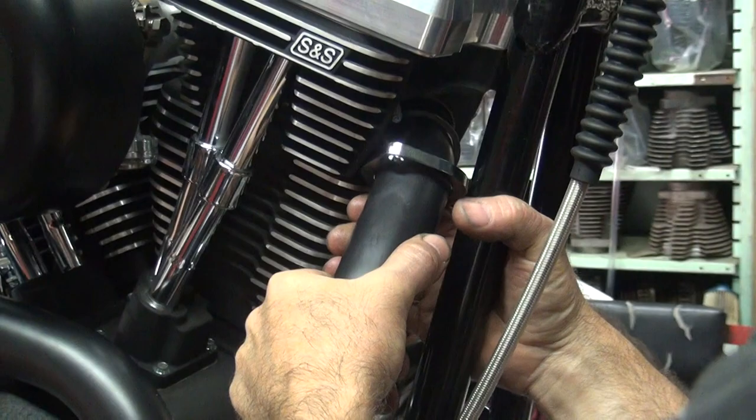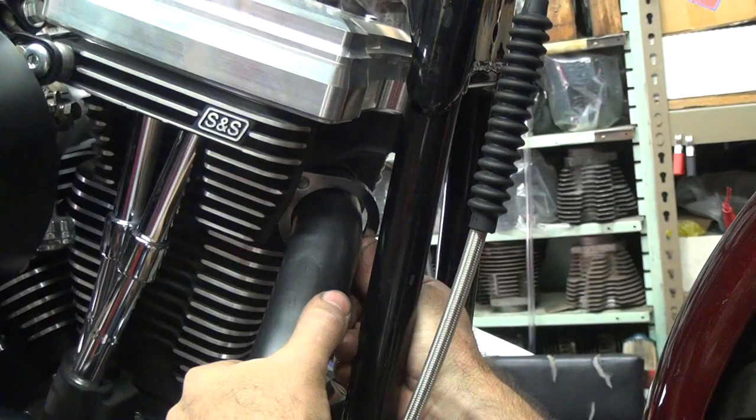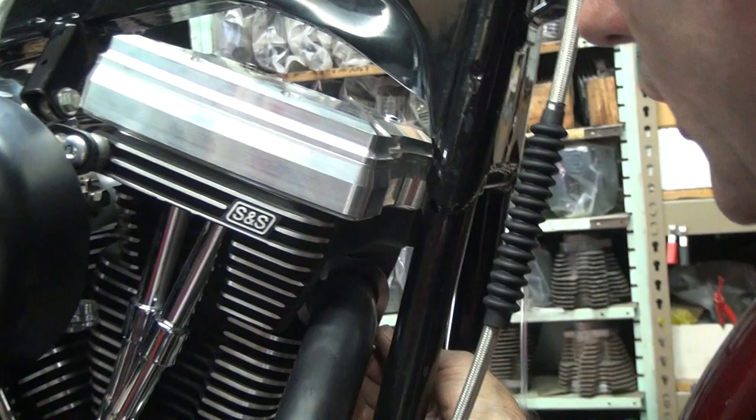Okay. See, this here, what I do, I take and I pull on it to get it to put the gasket in. The problem is the gasket's already damaged, but I'll have to live with it that way. Trick is you gotta pull on it and it pops in. Beautiful. If you try to force it in, that's when that gasket gets rolled over.